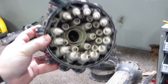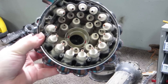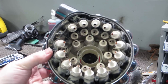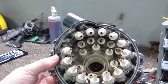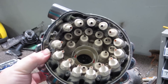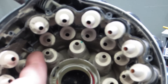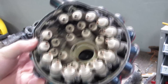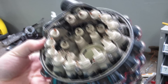When taking this apart, only take it down and clean it as far and as intensively as you are comfortable with. I'll pretty much take the whole thing apart because I'm putting it in the sink, and these don't dry well if there are pieces that can still trap water while together. The next thing you'll be looking at is a ring of exposed Torx screws around here — we'll loosen those up and I'll show you exactly what that loosens, what comes out, and where we move on next.